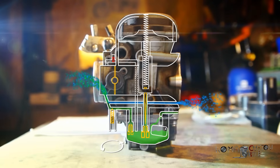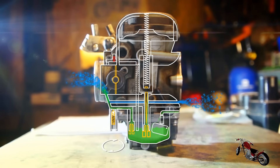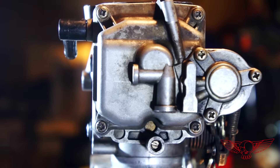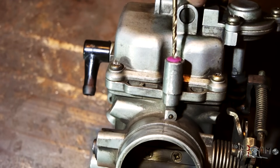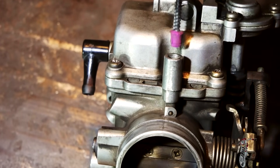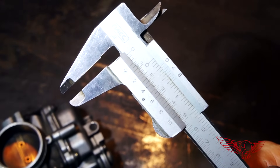But in my case, with the screw regulating the flow of fuel, we turn the screw clockwise to lean and counter-clockwise to enrich the mixture. In the other carbs where the screw manages the flow of air, we do the exact opposite. Just to be comprehensive — if your carburetor has never been adjusted, you'll have a factory plug pressed into the body blocking your access to the adjustment screw. You can remove it by drilling a tiny hole and then prying it out with a self-tapping screw. Just make sure you don't drill too deep and damage the screw, because the channel is only 6mm deep.